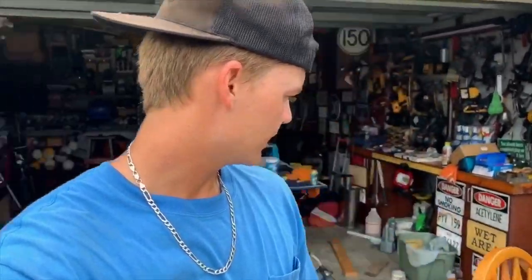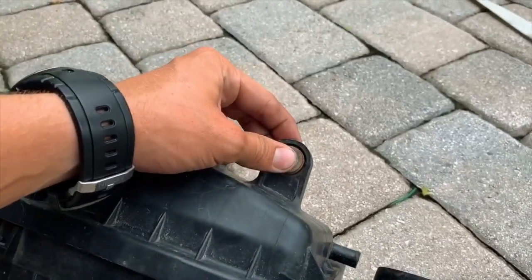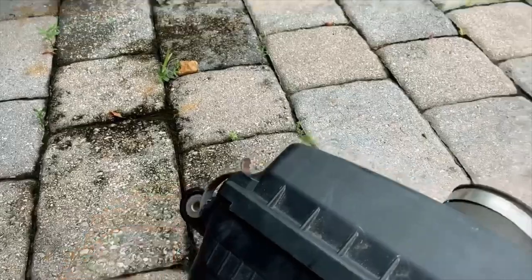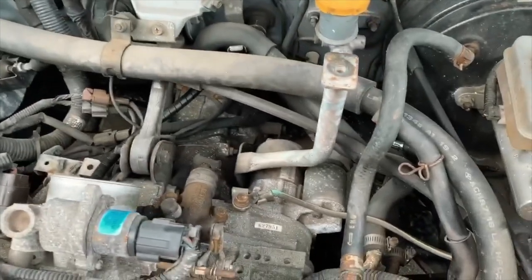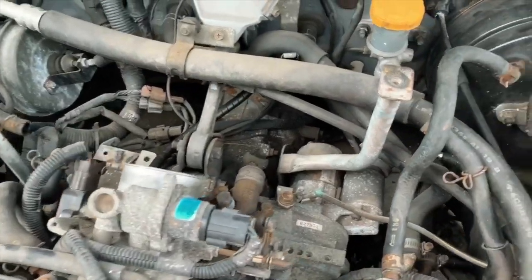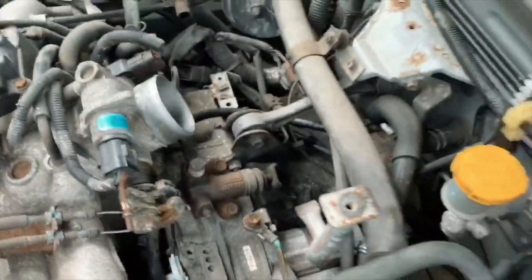It's a bit hot out, but here's a quick time-lapse taking that apart. On these Subarus you should have one bolt here for the airbox, a clamp that was super easy to take off, and one more bolt. After that you basically just pop it out, and it opens up all of this space. You can throw a t-shirt in here to make sure nothing else gets in - it allows a lot of accessibility for the slave and frees up room.